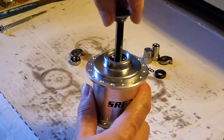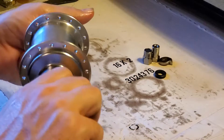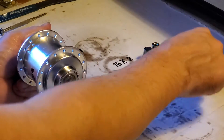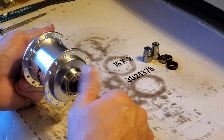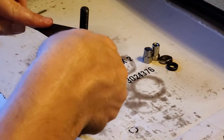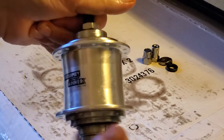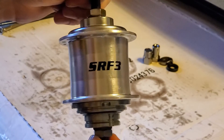Put on the non-drive side cone too, which will take a while to thread on. Just tighten it by hand a little bit. Put the lock nut against the cone, and then with the 16 millimeter wrench figure out where it needs to be. It should be like a slight bit of play that you can sort of feel, but that's about right. So that was taking apart and putting together the Sturmey Archer SRF3 three-speed internal gear hub.